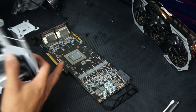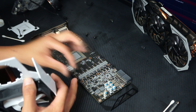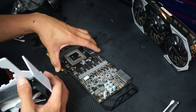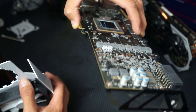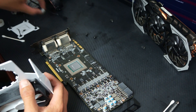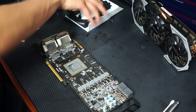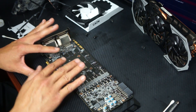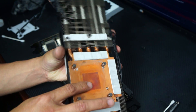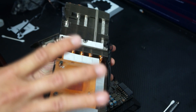I ordered separate heat sinks for the memory chips and for the VRMs. The VRM ones took weeks to arrive, so I ended up taking the ones I had for the GPU and cutting them in half — they fit on the VRMs without any issues. The ones for the memory chips were twice the size and didn't fit well, so I got new ones for the VRMs. Links to everything will be in the description. The 980 Ti G1 Gaming doesn't have a full plate — the copper plate for the GPU die also cools the memory, and there's a separate plate along here that cools the VRMs.